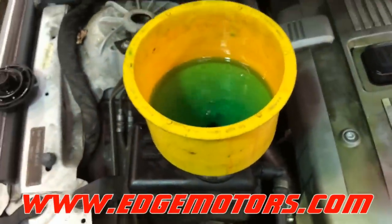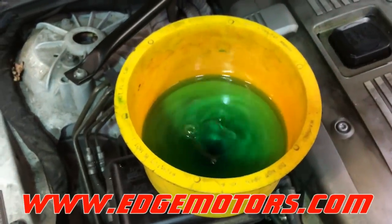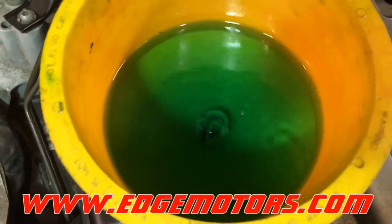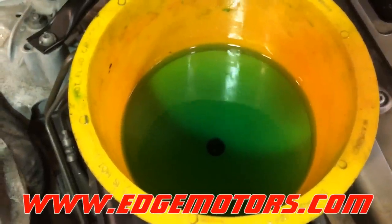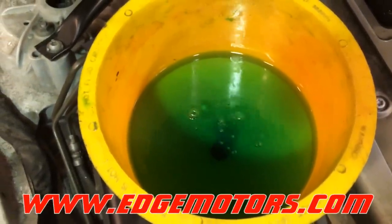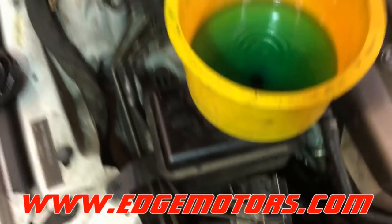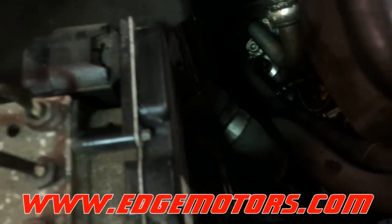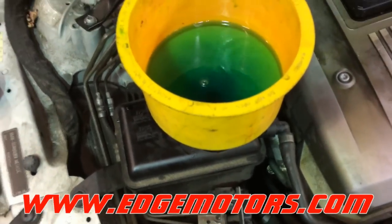The system is set to do it all at once, but I'd suggest doing the procedure a couple of times — better safe than sorry. You can see it's pushing the air out of the system. After about 10 minutes of bleeding, you'll see no more bubbles coming out, maybe just some small ones. You can hear the pump running and the coolant circulating through the system. The pump is going to turn on and off numerous times, so don't worry if it turns off — just wait for it to go back on. That's normal.